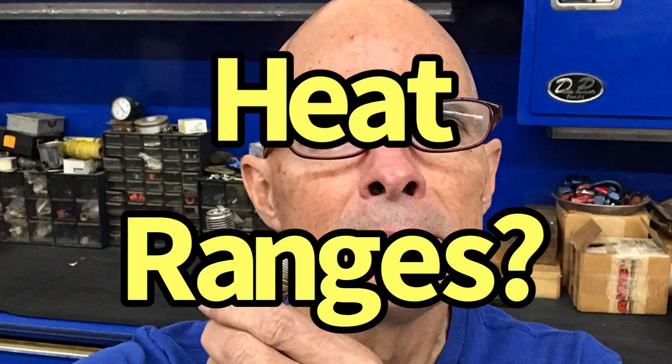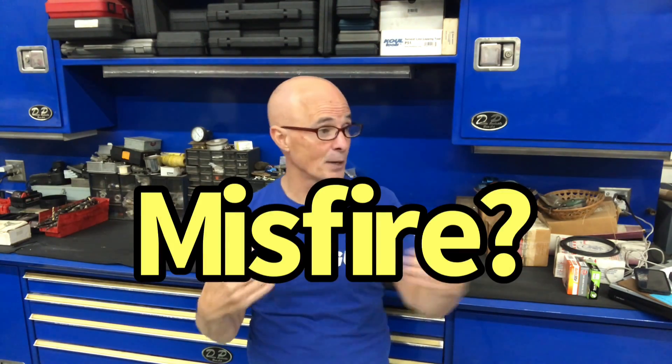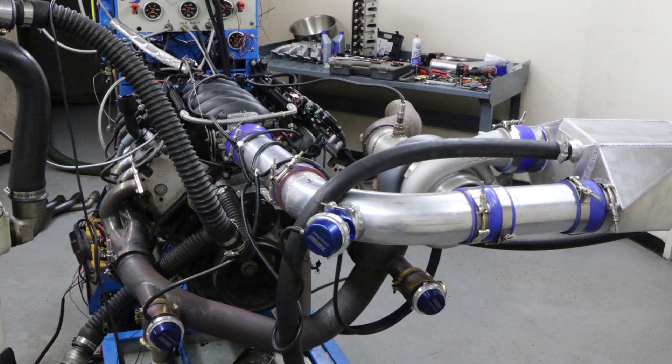As for heat ranges, we saw no difference in power from changing from a very hot plug to a very cold plug. The only concern is running a very cold plug on a daily driver — some guys report misfires. Personally, I've run IK-31s on the motor I ran at Bonneville in the Civic and drove it on the street, never had any problems. Let me know in the comments if you've had problems running cold plugs on the street. Normally guys run a little hotter; most OEM applications run them hotter. If we're running boost or nitrous, we go to a cold plug. I'm Richard Holder — make sure to like, share, subscribe, ring the bell. I'm trying to figure out if there's anything I haven't tested yet on spark plugs — if I haven't, let me know in the comments.